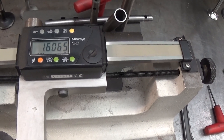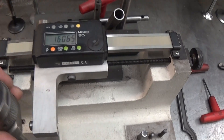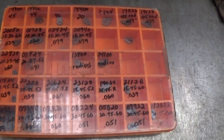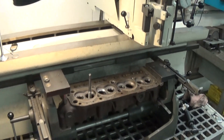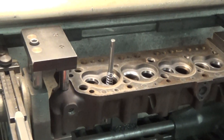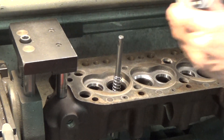You can go pretty close to the edge of the valve on an intake. So that's where I'm going to machine these valve seats, and that's the device. You can get all kinds of different cutters — I've got a box full of different angles and widths. I've cut one already, and I'm going to show you how the machine does this and the result you get.